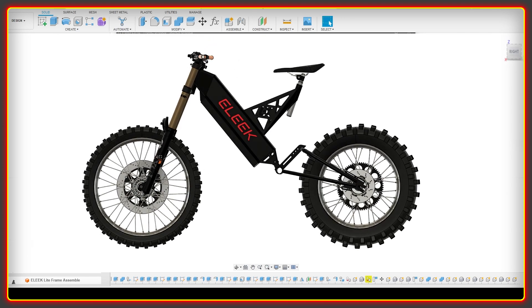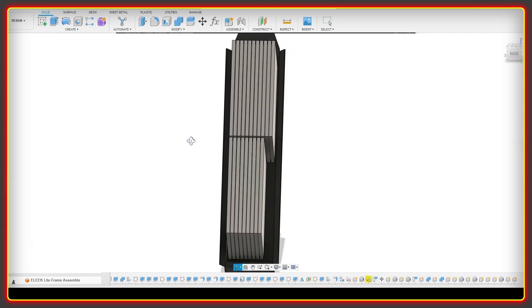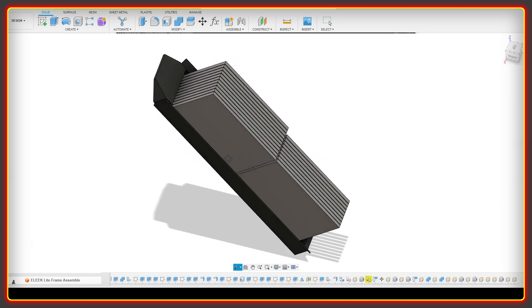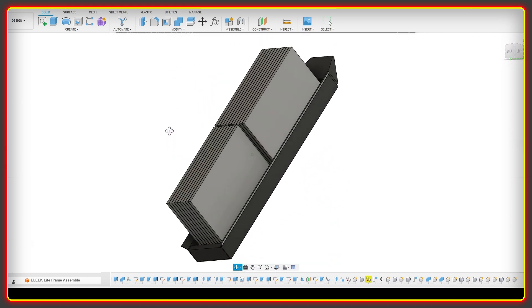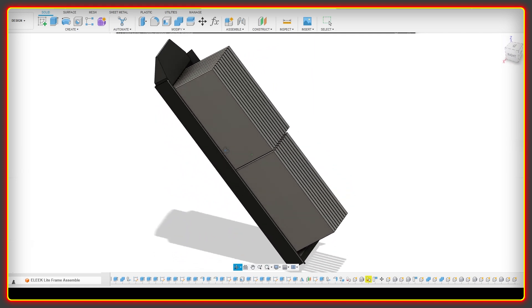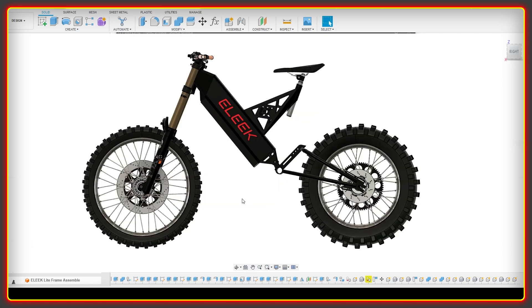The whole point of this exercise is essentially to let people run a slightly larger battery than is possible with the current space. The version I've done here has actually been sized with an eye on using pouch cells, so a battery here could easily be around 30 amp hours using those. With the existing size it's actually tough to try and get 20 amp hours in.